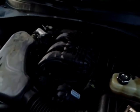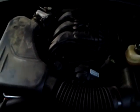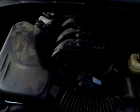So I just went around, swapped them all. You know, put my caps back in, hand tighten everything. Don't over torque it, especially these upper intake 8mm. You may not even see it, it's getting dark, sun's going down. But you can tell those are plastic on plastic. Threads are real wide, thick. They turn out really deep. So just do not over tighten those when you put it back together.